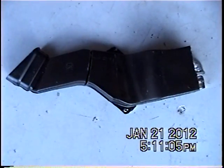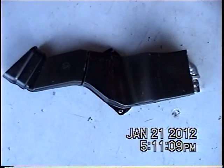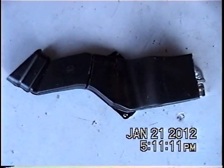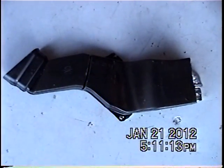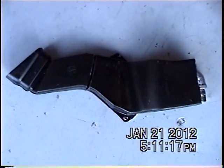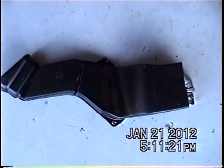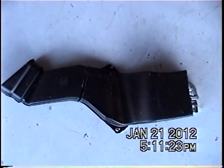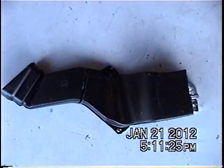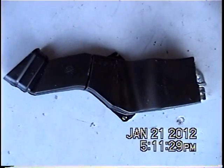And then this is an air vent that I ended up cutting actually in 2 spots, one right in the middle and then one on the far right. That gives you access to the heater core. Then I'll put duct tape on the backs of that and reinsert it and put duct tape on the top so the air passage is good, and secure it with the screws. That'll be up next.